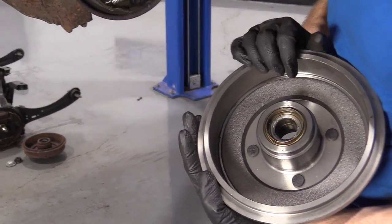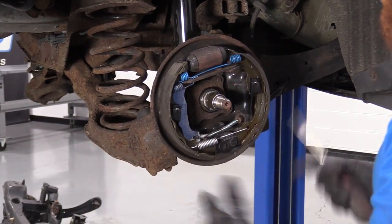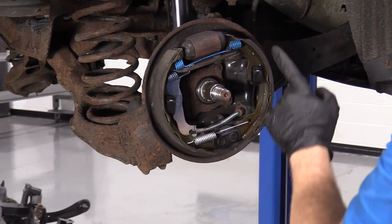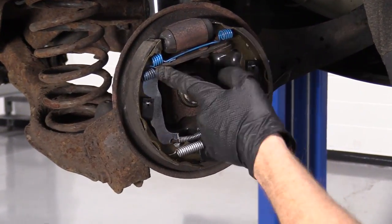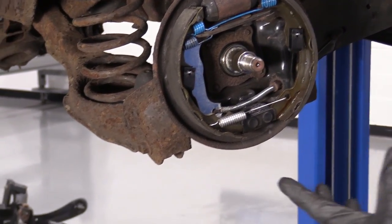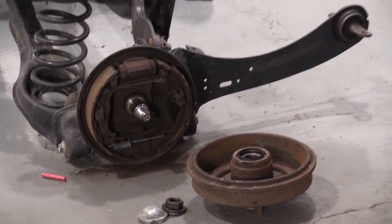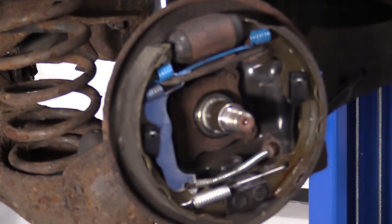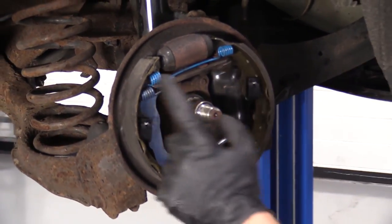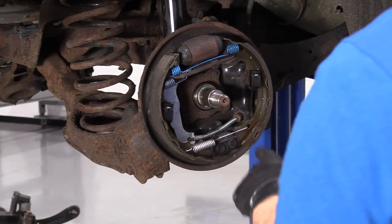The seal looks good — we got the drum off and we can see the brakes. The rear drum was brand new, rear shoes brand new, hardware's brand new. If you look at the old one, you can compare them and see which one you'd rather use — I would go with the brand new. If you've got two used sets and don't like either of them, just go on 1aauto.com and order some new shoes and new drums, and check out the video on that. We'll get these springs off real quick and then we can move along.